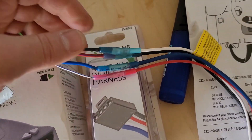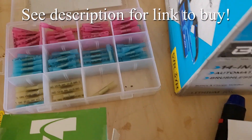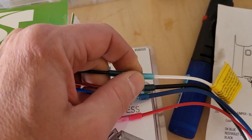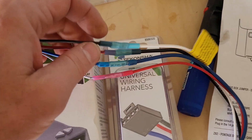Now, which I've already done — unfortunately I didn't really show you that — but here it is, wired together. It's pretty easy to do outside of the truck. I use these weather connectors here; I just prefer them all the time. They shrink down and they seal really well. They're just a very good connector, and when they harden up they're a pretty solid connection. I've never had any problems with them.